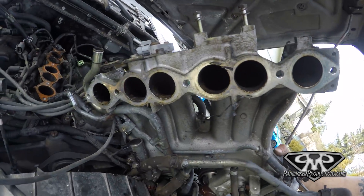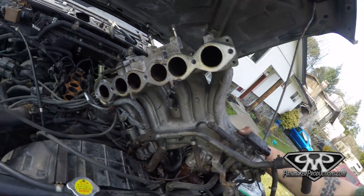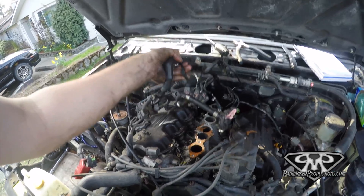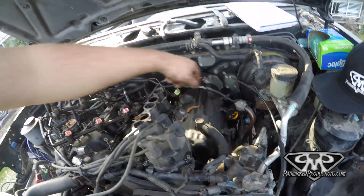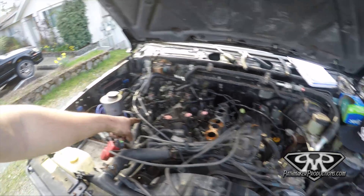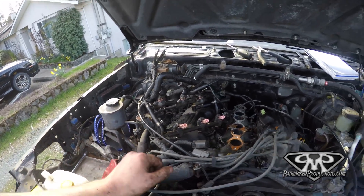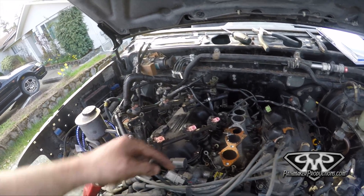She's burning a little rich - gonna be wanting to clean those a little bit. Not that much cause I'm pretty lazy. I yanked the fuel rails off, both of them. There's one more electrical connection on the back - I gotta pop this pin. I gotta take these four off but they weren't coming very easily; they're part of the main harness.